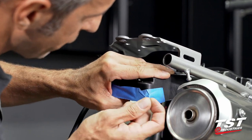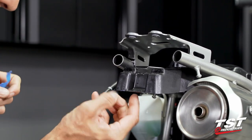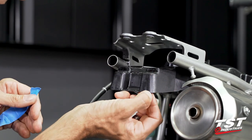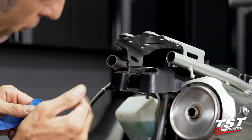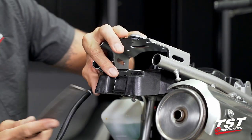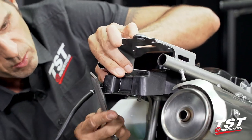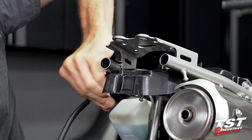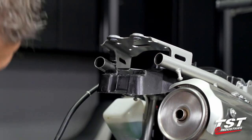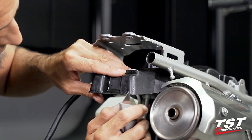The key to a clean cut using a knife is to not over-demand cutting speed. If you take your time and do it very, very slowly, moving the knife back and forth and letting the blade actually do the cut, you end up with a frill-free edge. If you want to refine that edge, it's very easy to do with a file. If any frills form, they can be scraped off.